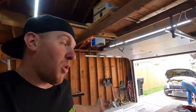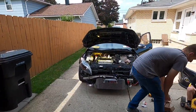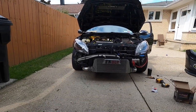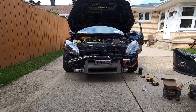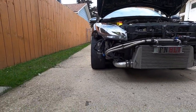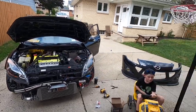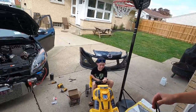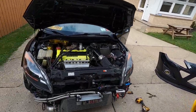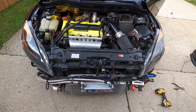Sometimes that's all it is guys - just the battery. I happened to think of logging voltage along with everything else to see if we had a drop and it was 100% that. This car looks so menacing without the bumper on. Still spinning through second gear even on the 30-pound map.